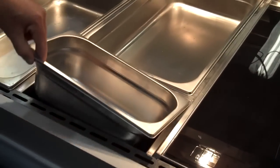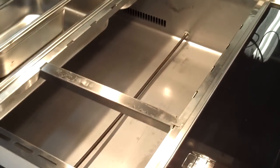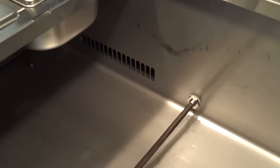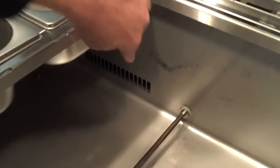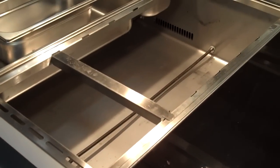The pans come out. The inside of the bottom of the case has radiused corners for ease of cleaning. It's a smooth stainless steel opening. There is also an air return underneath — this is a convected air case. Air flows along the back and then across the entire front of the case, giving a front-to-back gentle airflow over the products.